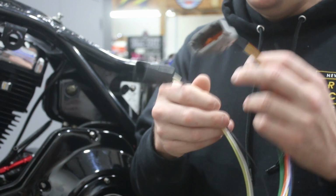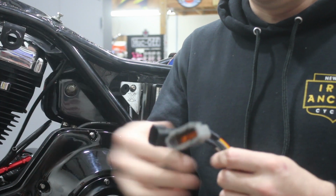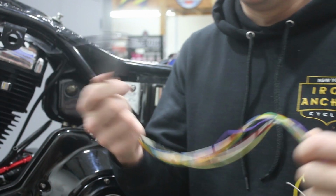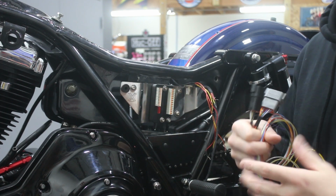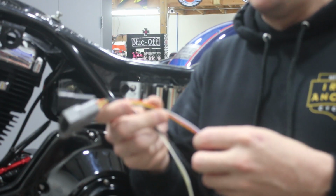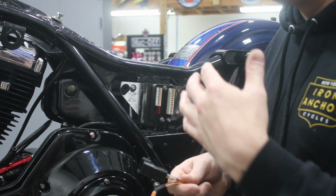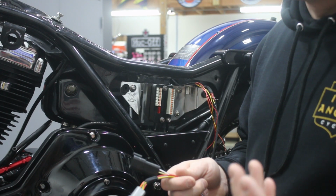So both of these are the bike side of the harness that will ultimately connect to the handlebars. So these 2 plugs are where the male plugs from the handlebars will plug in, and then this wiring harness will run back to the appropriate plugs here on the M-Unit or wherever they need to go. In the case of these wires, I believe all of them will run to the M-Unit. There are some other harnesses, however, where you'll have things that don't necessarily all go from the same place to the same place. Let me explain that a little bit.